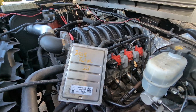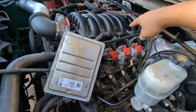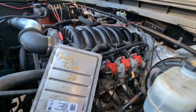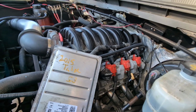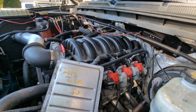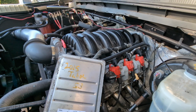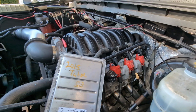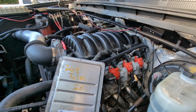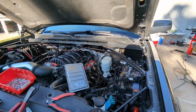But if you do change the fuel sensor, there's wiring underneath this intake, your fuel injection wiring, that has to get swapped out too. And we have all those parts, and you just match it up to what your vehicle currently is. That gets you around a lot of headaches. Don't do this if you're putting a 2018 and newer transmission in it, like an 8-speed. It can cause issues. So you guys can get a hold of me. I can help plan this out and make sure you don't have a bunch of headaches.